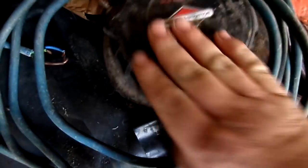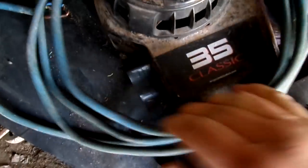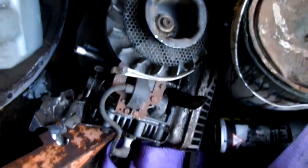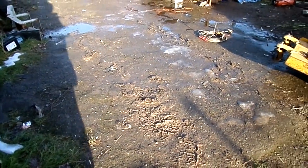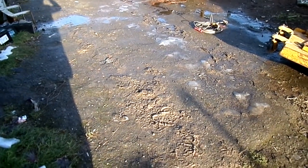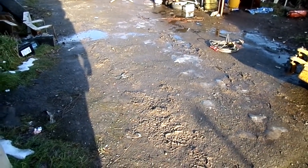I had a little classic Briggs by here — the 35 Classic. They are terrible for flooding, or rather filling the carb full of oil if you turn them the wrong way. Those engines fill up straight away with oil, and the air filter fills with oil too. You just have to clean it all out, then start it up — smoke everywhere until you get going again. You have to clean the spark plug as well, dry it, or change the spark plug.